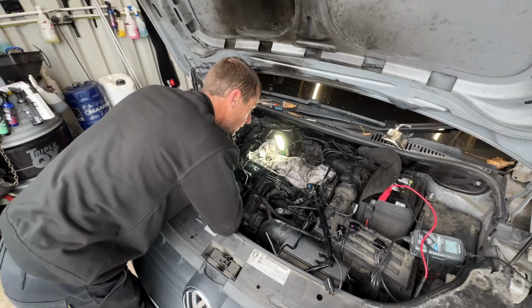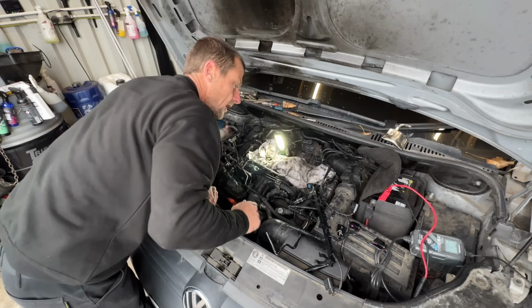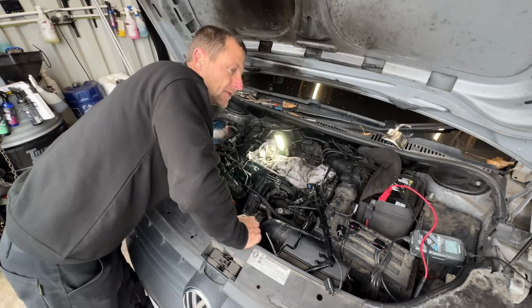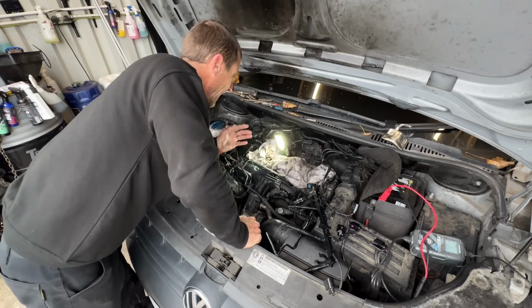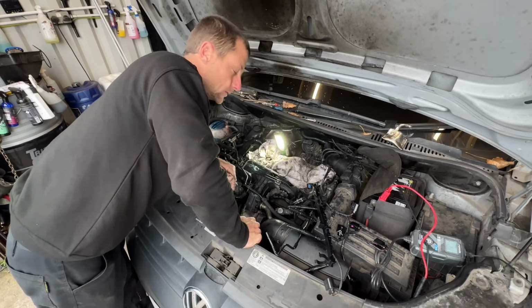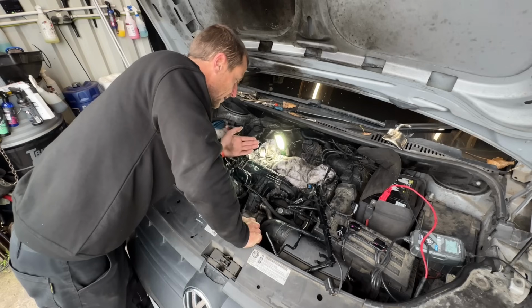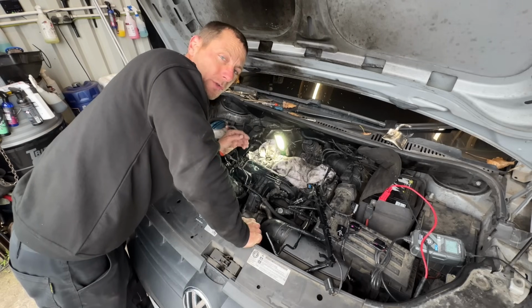Now, don't be in a rush and think I'm going to use a normal drill bit and tap and die it. I don't care whether you're the Queen, David Attenborough, or the Pope. If you use a normal drill bit and a handheld drill, you're going to drill down there at a wonky angle. And if you do that and make a mess, your cylinder head's knackered, you're going to have to replace that, and it is going to be not cost effective.